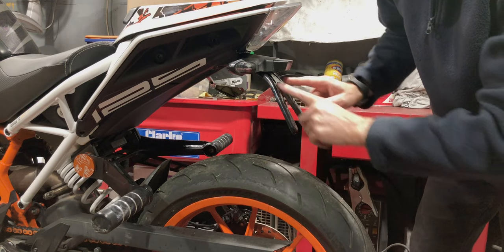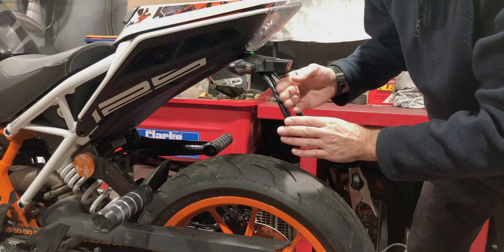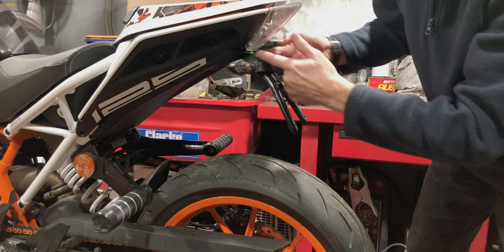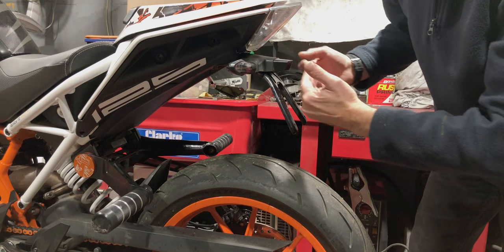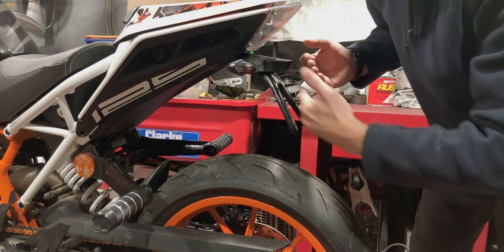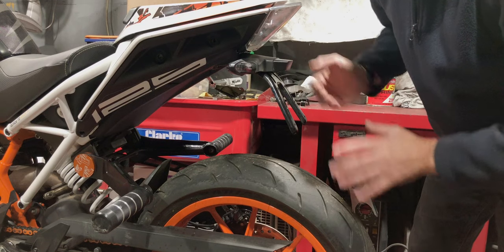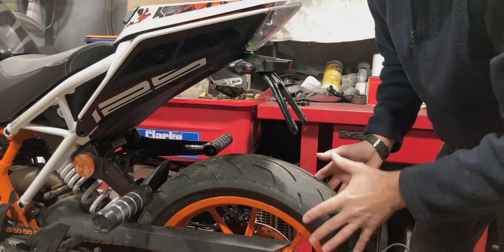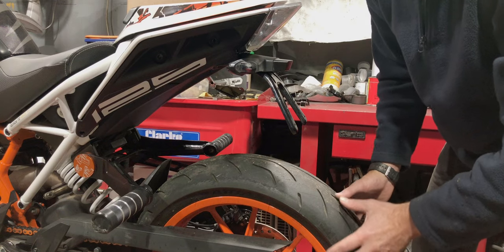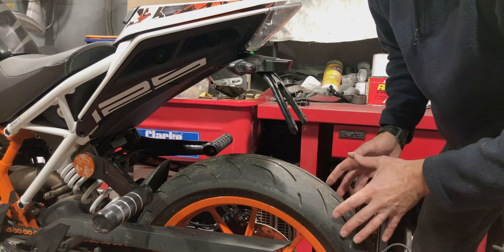So, if you want to keep this angle on the back, what you need to do is to not cut it as short as I have here. You want to bring it out to about here, and then it'll clear the tire nicely. If you've got a hugger down here, like some, for example, the Indian market bikes have, you'll need to allow a bit more room.